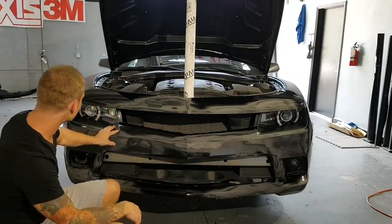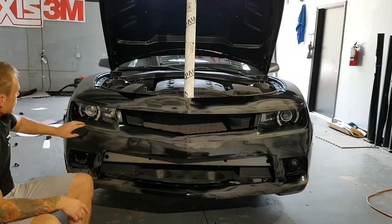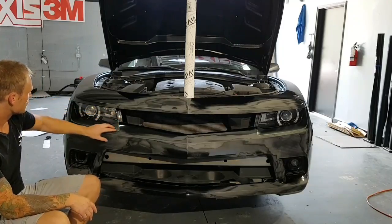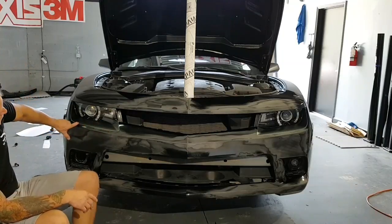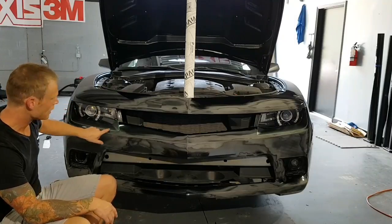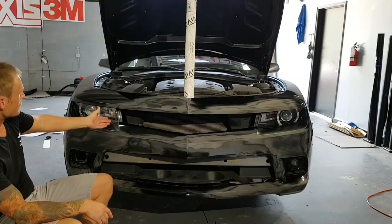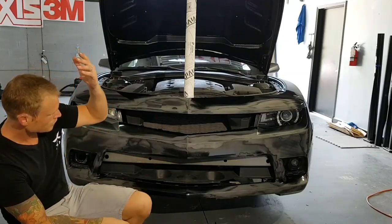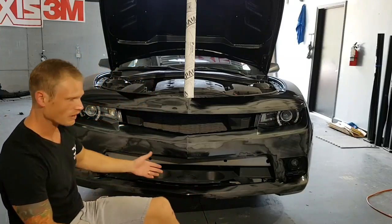So what we've done here is we've done inlays under the headlights, and we've put down knifeless tape again so that we can cut that inlay, cut the piece out afterwards and have a nice clean edge once we overlap this line. Again, we've just left a little bit of overlap, maybe 1/8 of an inch, and that's about it. So again, we're just going to do that, and we're going to have complete coverage there. The rest of the bumper is pretty straightforward, shouldn't have any issues with it. Like I said, it may not stick, we're going to find out.